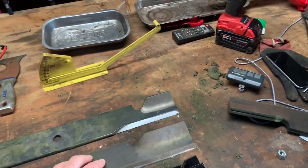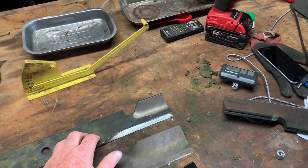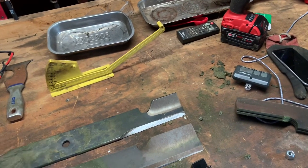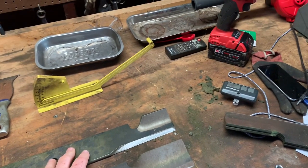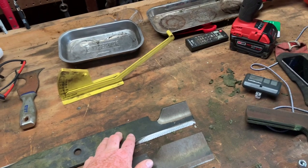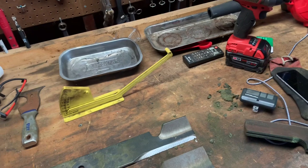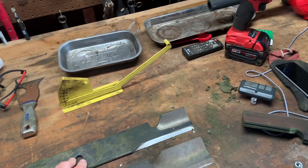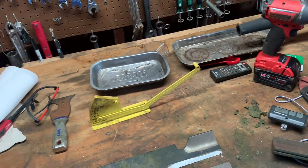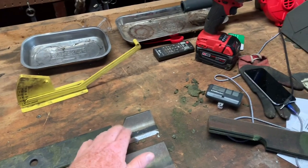Think of all the blades I have to buy — the stock blades come with the mower, but then I have to buy a set of small fin blades and keep an extra set just to cut grass with it. But with the small fin blades in the fall and spring, man, does it cut really well. In the summertime the stock blade cuts well since it's drier and you don't have to do a lot of double-cutting. With the ICD deck using these blades in the spring, I always feel I can get out of a mess. I don't feel like there's a mess I can't clean up. I can't say that about the Toro in the spring — there are situations, like a wet, dewy, high, fertilized lawn, where you feel like you can't get out of it. I've never felt that way with an ICD deck using these blades.